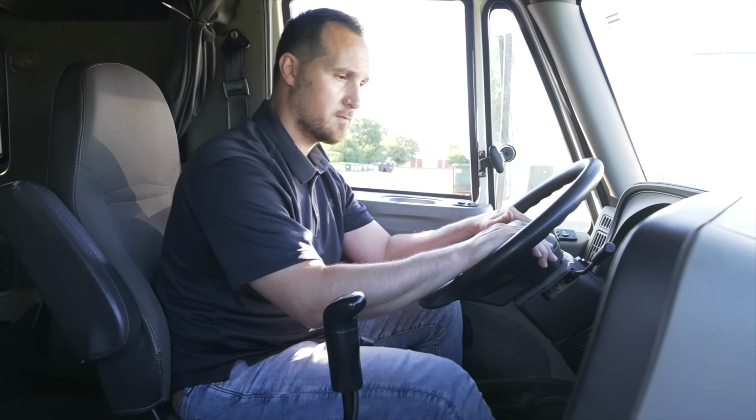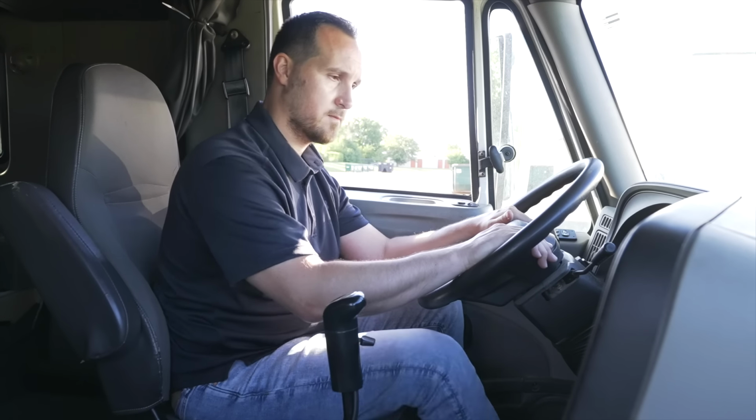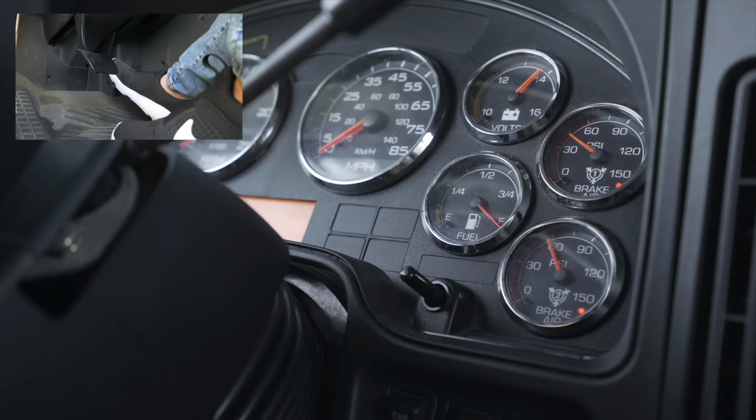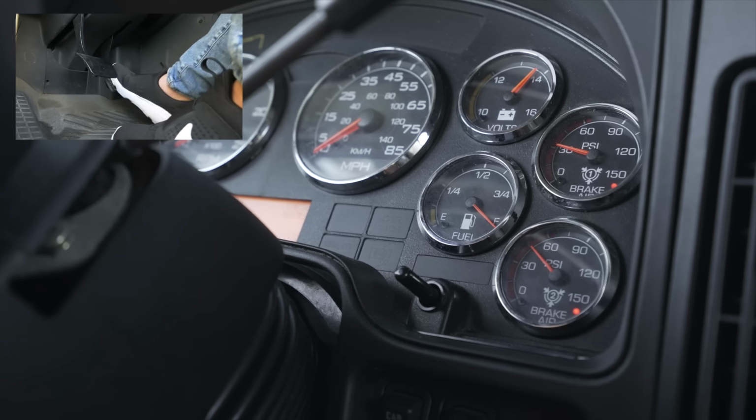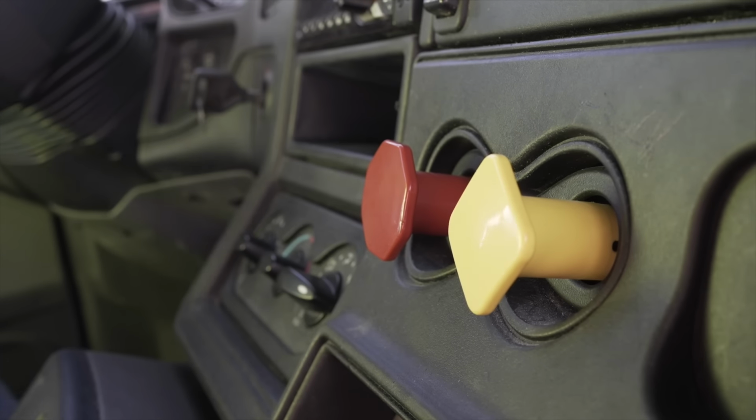Now I'm going to keep fanning for my buttons, which is B on the lab test. Around 20 to 40 PSI, my button should pop out to make sure my emergency spring brakes do work. So let's start fanning. Keep on fanning till both buttons pop out. My buttons did pop out. That indicates that my emergency spring brakes are working. My lab test was successful.